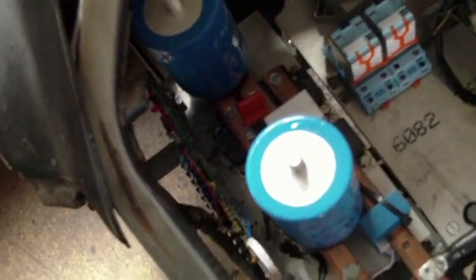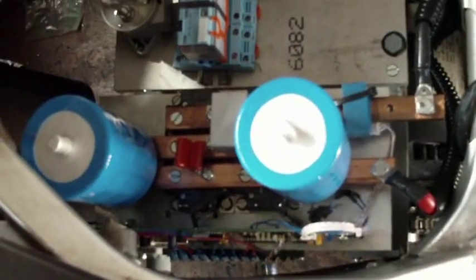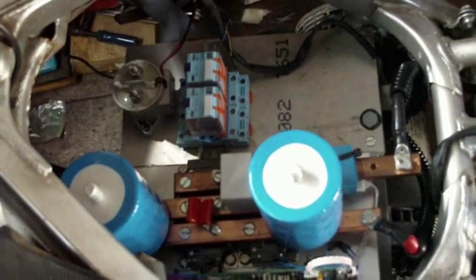First, we can see the controller is finished, bench tested, and installed. I've also got the motor traction cables done. There are the traction cables — all done in black conduit just to protect the cable. It's all 35 square millimetre flexible copper cable.